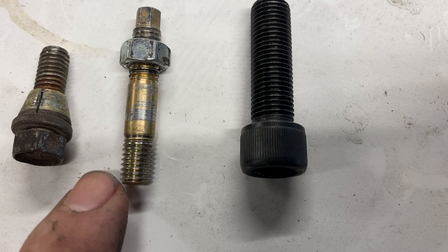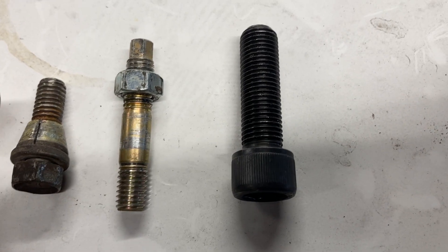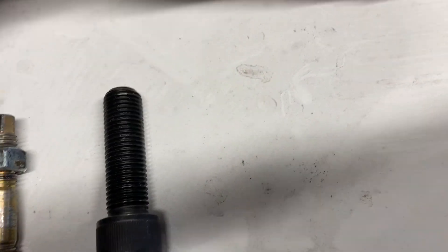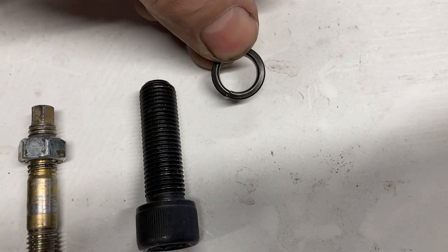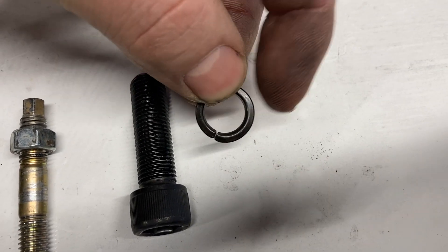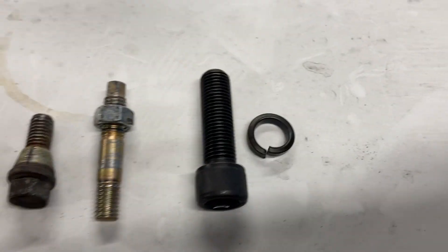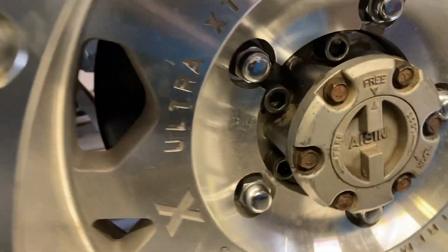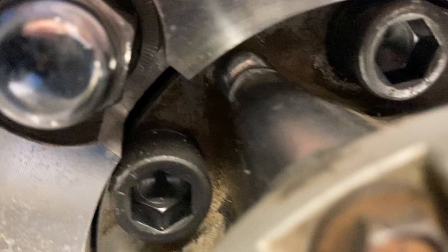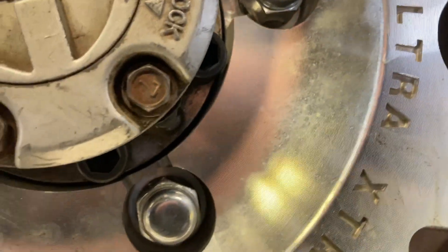The thread engagement on these is really in the hub - it's only about three-eighths of an inch deep. This 7/16ths gets about a full inch of thread engagement into the hub, makes it a lot more stable. Also run lock washers, but make sure you use ones specific for button head or allen bolts because they're narrower on the OD - they fit under the head better. You can see another reason to use allen-head-specific lock washers is just for space; the wheel basically scrubs over the heads of the bolts when it goes on.